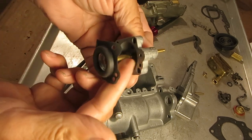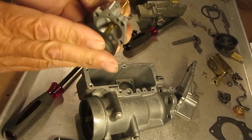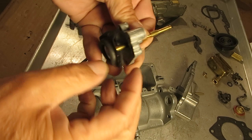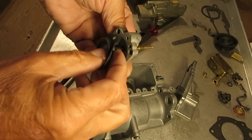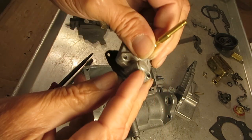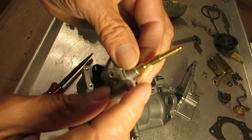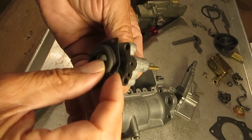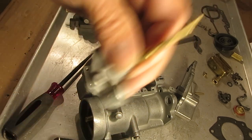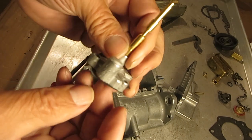To get gas in here, this part fills up with gas — this is the reservoir — and the bottom is dry with no gas down there. When the diaphragm is pushed down, the suction from it pulls fuel in from the float bowl through this passageway right here. There's a check ball in here, and I don't suggest you take that apart unless you've got corrosion. Otherwise leave it alone, just make sure it rattles good, and clean it out with carb cleaner.